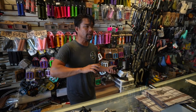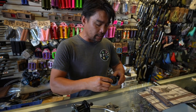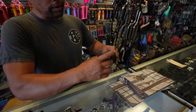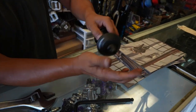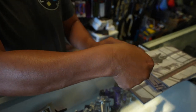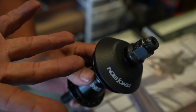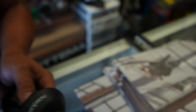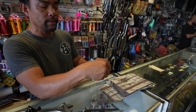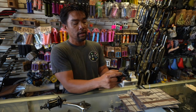Believe it or not, here at the shop we rarely use any kind of cleaner unless it's old school and caked on there. Otherwise we just get a rag and wipe it off. One other thing I actually also forgot because it's these little minor things: when you guys are disassembling this — this is a brand new hub so you don't see it — be careful, look at the end of the axle. Some of them, because it hits on the ground, it gets smashed. So this thing unscrews freely, but when you get here and it gets rough, that's because that thread is so messed up. If you continue to unscrew this, it's going to jack up the whole nut. The ends are all chewed up. Get a file and file all that down, put it on the grinder and grind that little section off — just get rid of that messed up thread. Or better yet, just cut that section off, clean it, and then unscrew it out. Otherwise you get here, you're like, 'Oh dude, it's rough, I'm gonna force it out,' you unscrew it, and it will completely destroy that nut. It will never come back in.